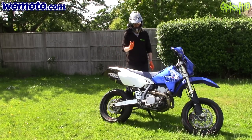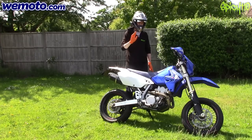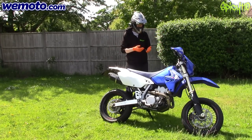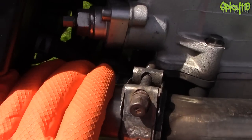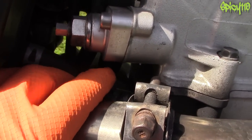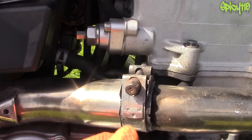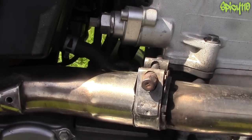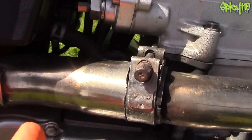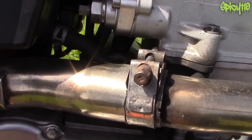In this video I'm going to quickly whip the starter motor out of the bike. I hope nothing goes wrong, then we're going to go to the garage, take it apart, clean it up, put it back on the bike and we should be done. It's a bit hard to see but down in there is the starter motor — basically a bait-tin-sized thing with two bolts holding it. To get it out we'll need to take off the mid pipe and end can, possibly disconnect a hose, then undo two bolts and the wire on top.